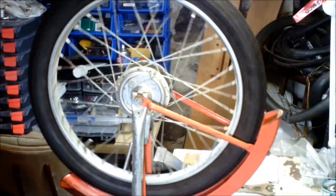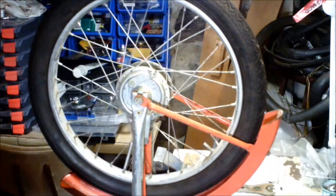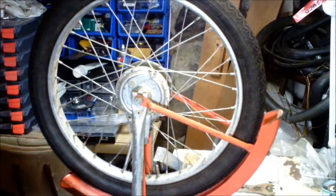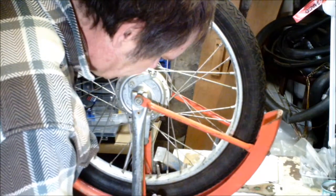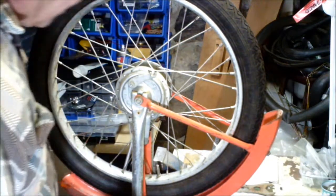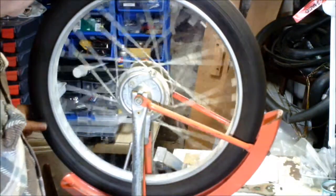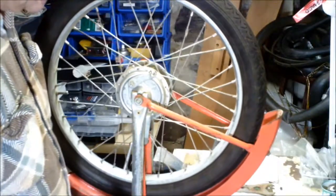See if it finds the same heavy spot. Put a mark there. Now I'm just marking it up in line with the stay for the fender — that's being a reference point. Give it a roll the opposite direction, a little bit slower than that. You should be there waiting for it to settle.